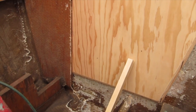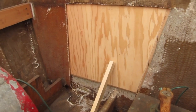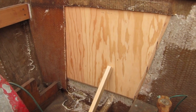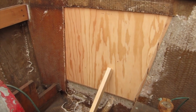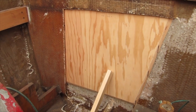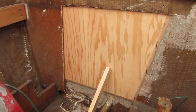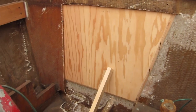So I'm going to go outside now and mark the hole and cut it close. It doesn't have to be perfect. I'll fix it later. I don't actually want it to be perfect now, because if it shifts or something, then I'm screwed. But I can always sand it later on to the actual hole that's in the fiberglass now. Match the muffler exactly with a little trial fit. So let's go do that.